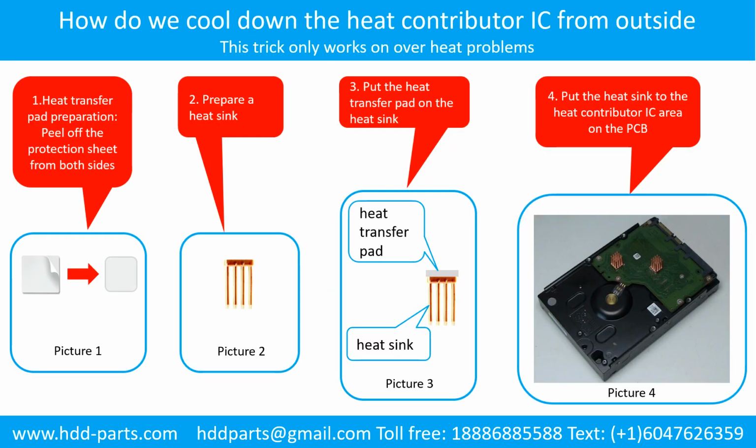How do we cool down the heat contributor IC from the outside? Step 1. Heat transfer pad preparation. Peel off the protection sheet from both sides of the heat transfer pad, as picture 1 shows. Step 2. Prepare a heat sink, as picture 2 shows. Step 3. Put the heat transfer pad onto the heat sink, as picture 3 shows. Step 4. Put the heat sink on the heat contributor IC area on the PCB, as picture 4 shows.